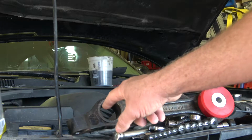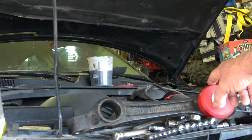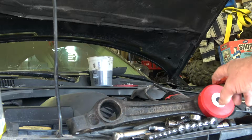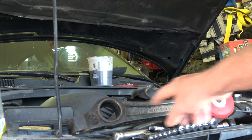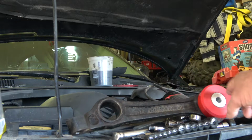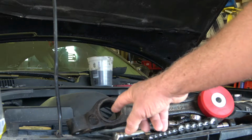The thing is, this is the only place where you take the metal sleeve out, because you use the metal sleeve on this end. You leave that sleeve in there for pushing these bearings in. And I burned both of the rubbers out of both of these at the same time, but now I have to take this sleeve out, which I will do with a hacksaw.